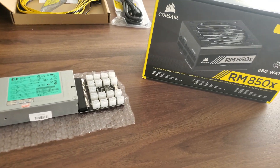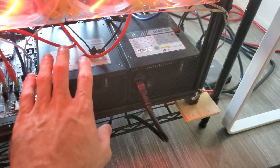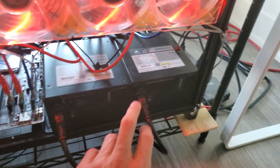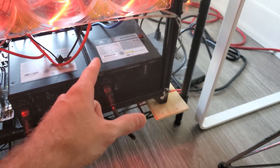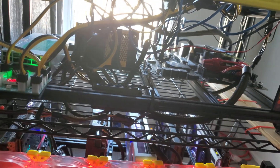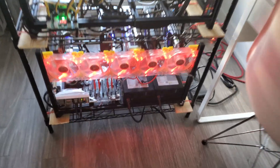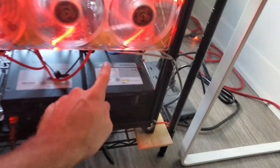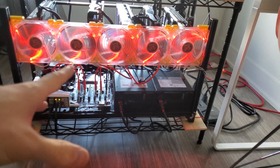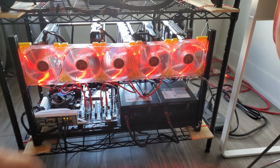I'm going to jump back to the rig. You guys see these two RM850Xs — what I'm going to do is leave the one plugged into the motherboard and CPU, and replace the second one with my new server power supply with the 17-slot breakout board. Then I'm going to move the RM850X up here to replace the bronze 850-watt power supply and retire that guy. At the same time I'll change the breakout board here from the one with a button to one that has a switch. I'll start by shutting down the bottom rig, unplugging all the cards on the server PSU, and making sure everything works before swapping things in the top rig.